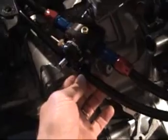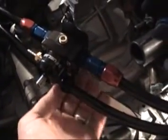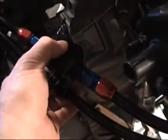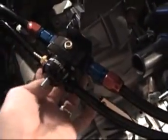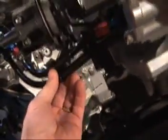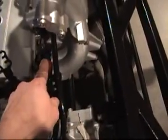This is the fuel supply line, and I'll have 2 of these little brackets on here going through the screws that hold the regulator down. So that'll hold that nice and tight across the bottom over there. Going up here, I've tied a couple of these brackets together to hold it in position here, and then here, and then this one goes across to the other side.